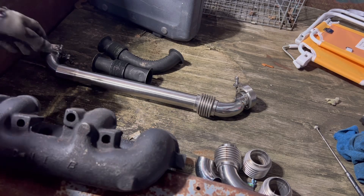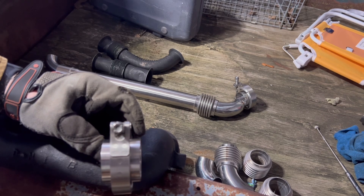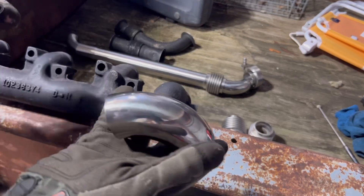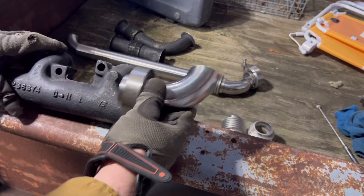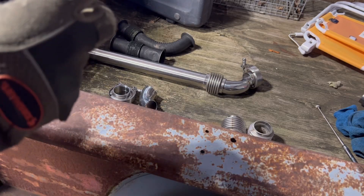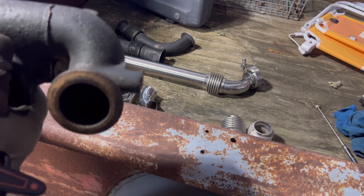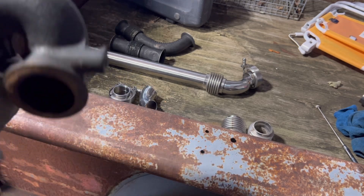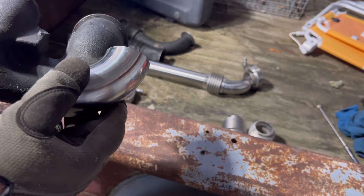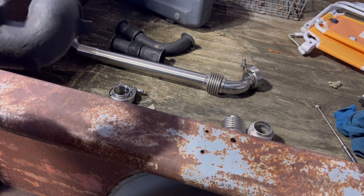The plan for this is to lop it off, put my V-band right here, and see if I can do anything to get a regular elbow like this little guy here to run right at the head, just like the driver's side. When I look down inside here, there's a plethora of room. Yes, these are cast iron, and I know welding cast is kind of frowned upon, but if you preheat it, do everything right, use high nickel rod, and then let it cool in sand, it's not going to crack. Hopefully. So this could easily become our new elbow here — run that right up close to the head, and that takes care of our problem of putting a V-band right here. That way these up pipes come on and off easy, and I don't have as many issues getting to and fro along the firewall.